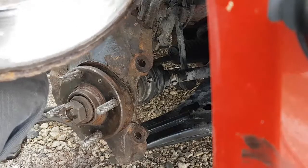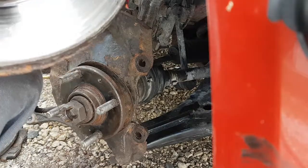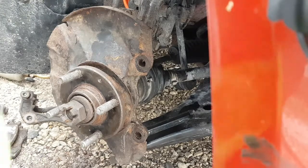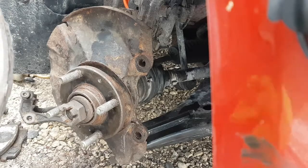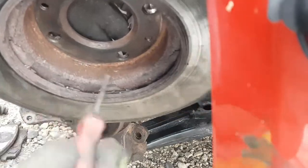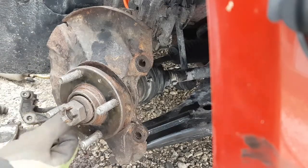And it's around the center hub here. Just quick cleanup. Oh yeah, now all the stuff's falling out. Okay. This is the joy of trying to put used rotors back on, is the loose rust falls in there when you're trying to do it. So you gotta be careful when you put these on. Don't bang them around too much. Let's see if there's any chunks of stuff here.